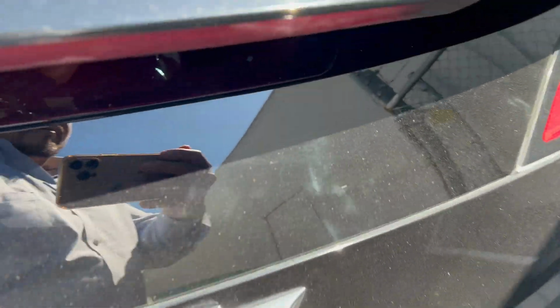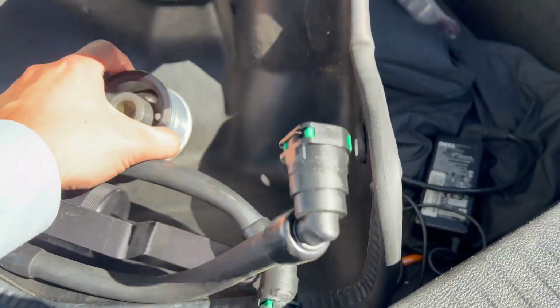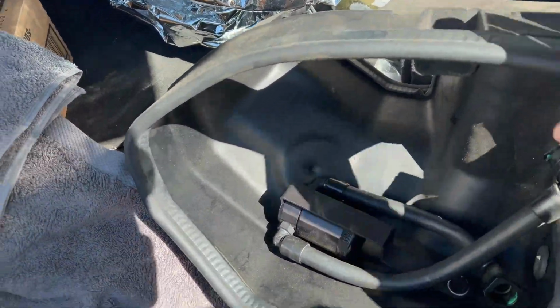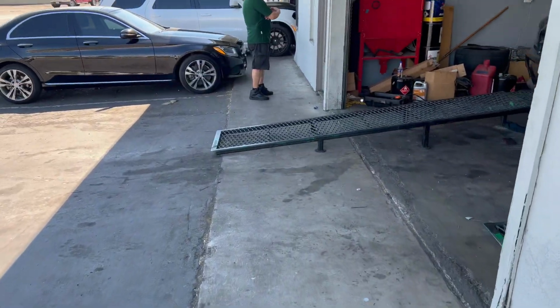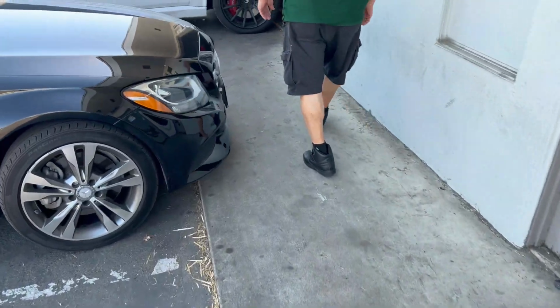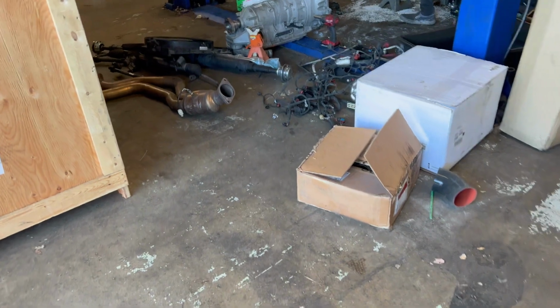All right, let's get the pulley. All right, so here we go. We got the catch can and the pulley right here with all the bolts. That'll work. All right, so this is for the JLT intake, and then as you know, the JLT catch can. And we're just going to use the existing pulley because with the existing pulley, we don't have to retune. So we'll come back later and do, this is a 2.8, so we'll do like a 2.7 or 2.65 and a dual pump later.